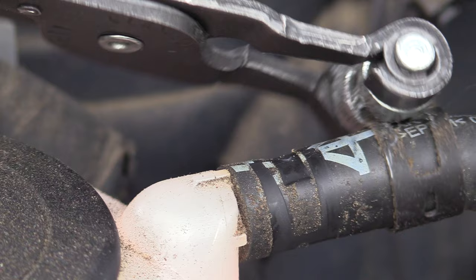There are a couple of tools where brand does matter, one being these Bluepoint hose clamp pliers. The key is the dual cups that grab the hose clamp much better than the one that just has a U at the end. This has been my go-to set for many years. There are also a lot of people who like the cable-driven hose clamp pliers — those can work well, but really don't buy the cheapest ones. I had cheap ones and ended up giving them away because they did not work well. There are places where cable-driven ones work great, even better than these, but don't cheap out.